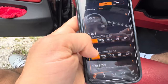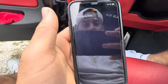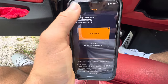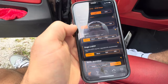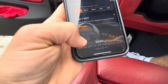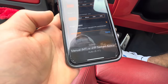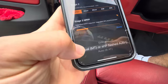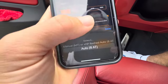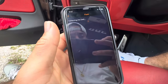It's very simple to flash — you literally click it, it contacts the DME. Let's go to Stage 2 as an example. I have the XHP flash on my car, which is a transmission tuner, so I would select that, but if you don't have a transmission tuner just put automatic. Then click Stage 2 and connect to the DME. Remember your ignition is supposed to be on the whole time.